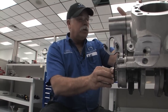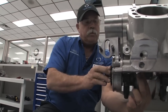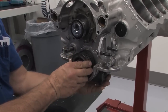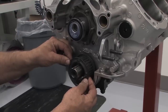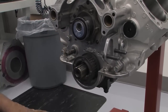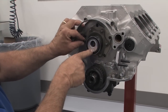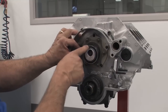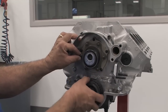Install the lower gear and turn it a little bit as you push it so that it'll go into the seal. Push it back and make sure the lower gear went into the seal area properly. Pull it back out, pop it back — feels good. The dowel pin is located right in the middle of this hub. You can't see it, but the dowel is located right there, so you're going to line up the dowel to the crankshaft key.